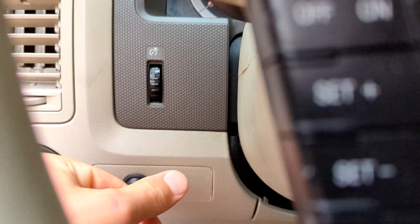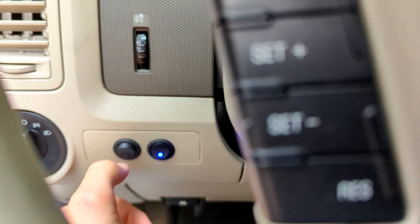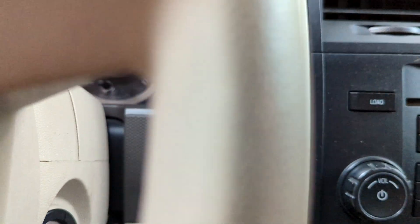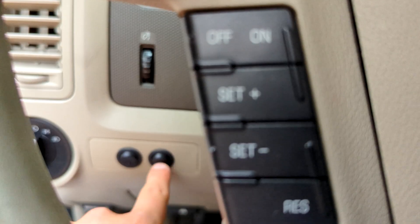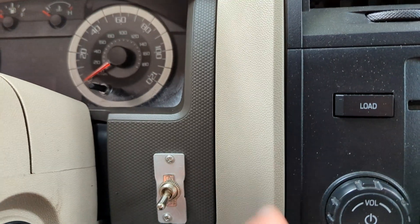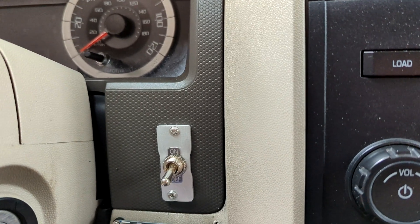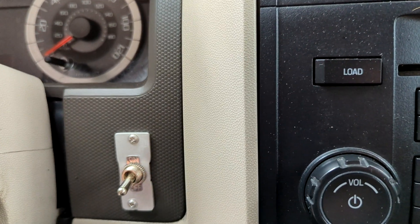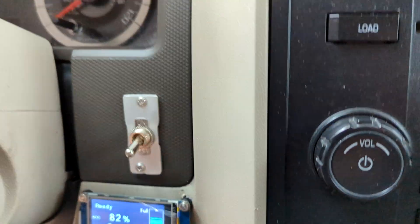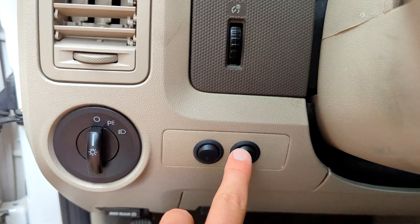I'm going to turn it back off before the coolant pump starts. So into drive, and that has to be on for this to work. The output here is powering this switch, and then this switch powers that Curtis relay — that's for the inverter. So in order for the relay to get power, both of these switches have to be on: both the main on-off switch and the BMS drive mode switch.